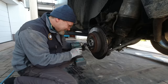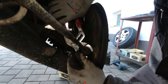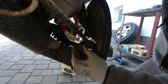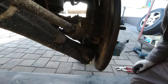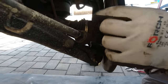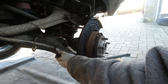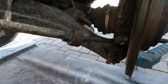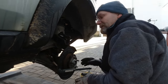I've got this secured right here so it's not going to drop throughout the repair. I'm using a siphon plier to remove the cable nut here - don't go on this hex head, it will snap off right away. I can get the nut off easily because we got plenty of copper grease on here. If you didn't do that when you assembled it, you're going to be already stranded on this nut. The other half of you who got the nut off but the cable is still corroded in are going to be stranded at least there.